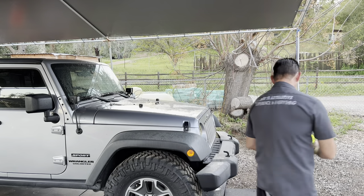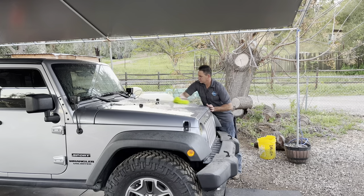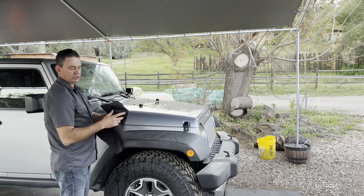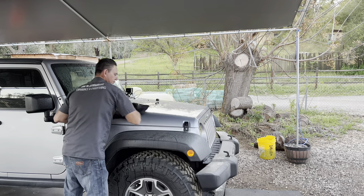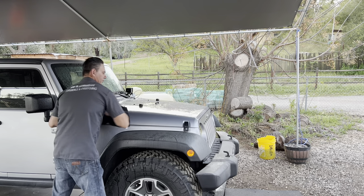I will put a link for the car wash soap I'm using in the description. It's called Clean Slate by Chemical Guys, designed to remove the wax. Also, when you dry it off, you want to use a clean microfiber towel. Make sure it's nice and clean and dry the surface so you don't put scratches and swirls on your paint.